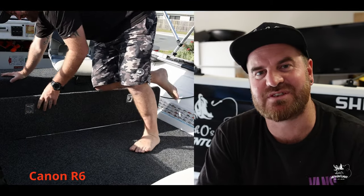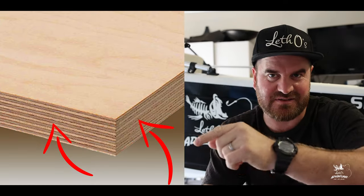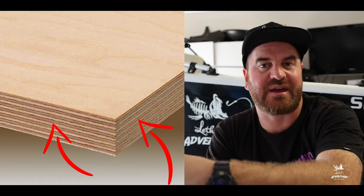I managed to put a hatch in the front — you can see it in the picture on the right. The hatch is awesome, I use it for a lot of stuff. It's not huge but it's big enough. I had to treat the wood before carpeting it, so I used Norseal epoxy wood treatment, which makes the wood super water resistant. I did three coats on all the wood. You especially need an extra couple of coats on the sides of the plywood because that's where water can seep in.